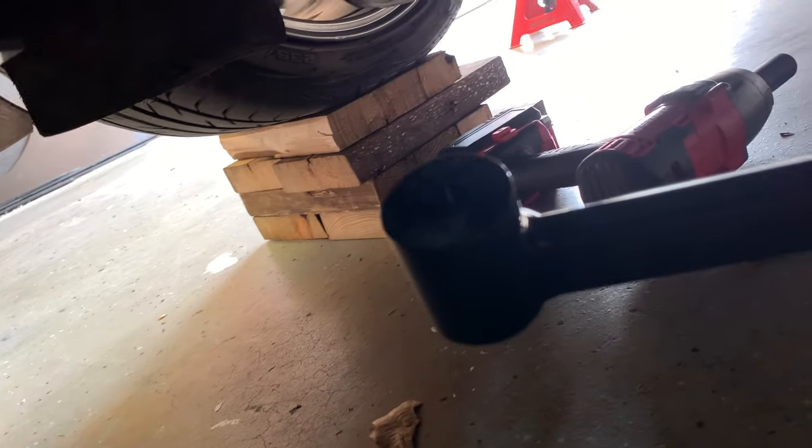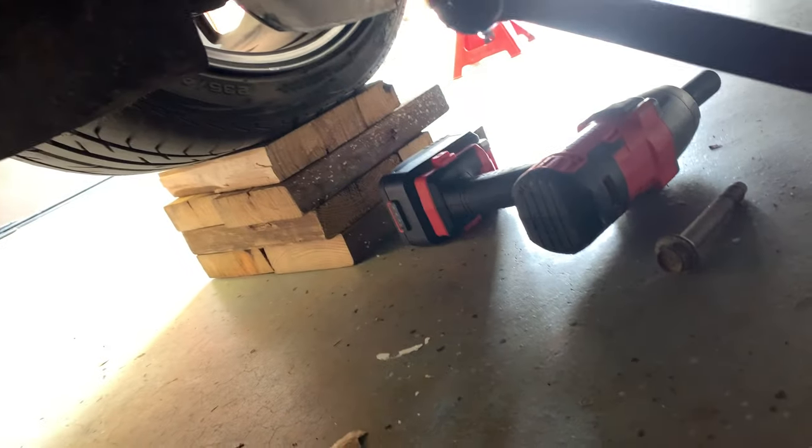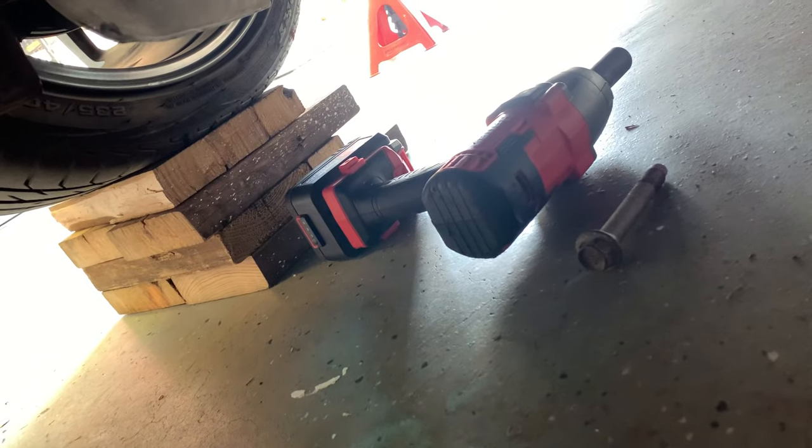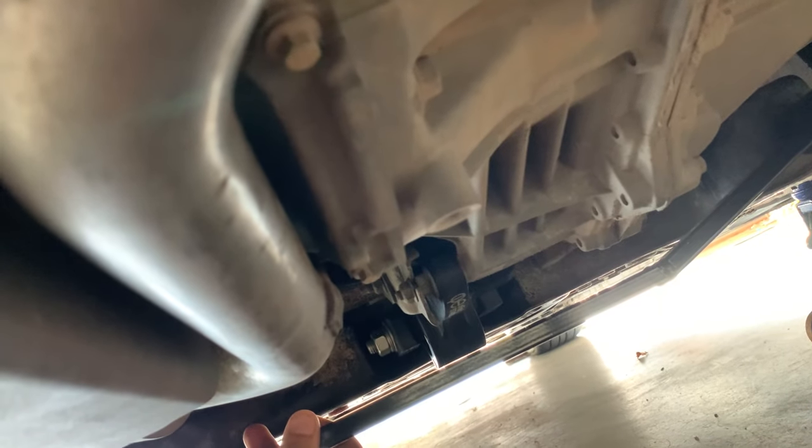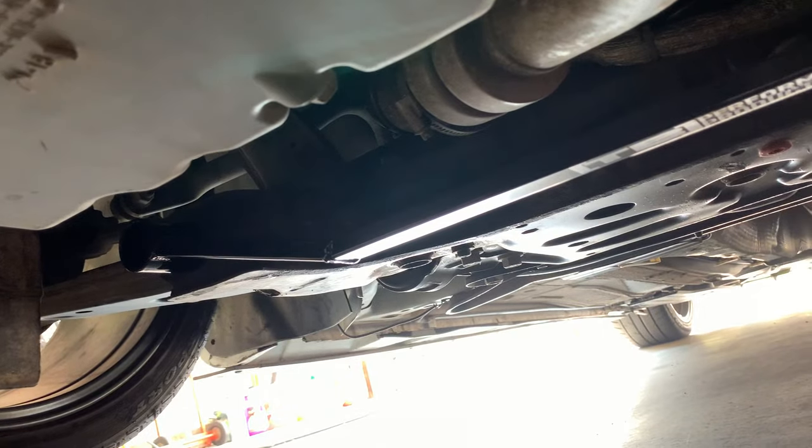You can see there's that end right here which has a hole for the bolt, and the flat end there is what goes up against the car like that. Then you just thread the bolts through, and I'll use a torque wrench to torque them to 110 foot pounds, then give it a 90 degree turn and it will be all good to go.